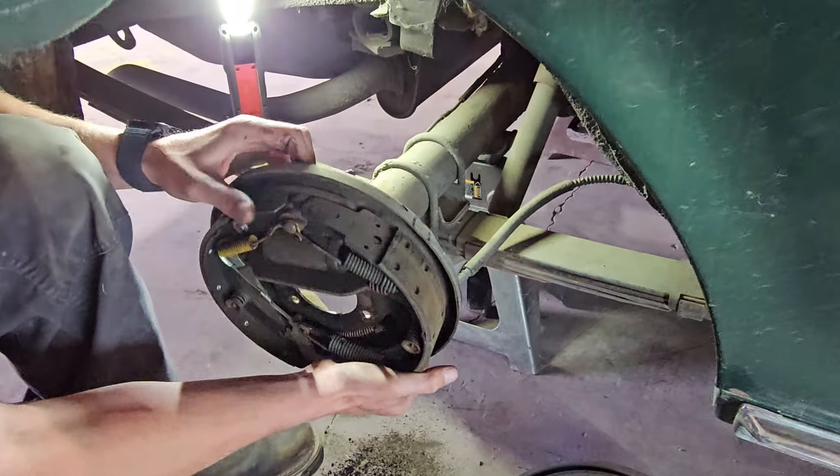We're going to wire in our new sensor and get this master cylinder put in. I'm going to tighten up our rear fitting first before I install it so I'm not fighting it while it's hooked up. We're going to finish tightening up the passenger side front line, then tighten up the driver side front line. The front calipers would normally require a banjo fitting, but this kit comes with a straight hose — we'll just use a crush washer on that and tighten it up.